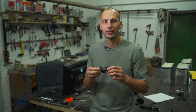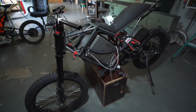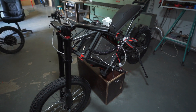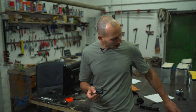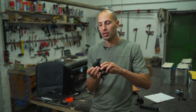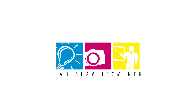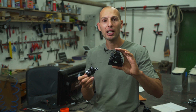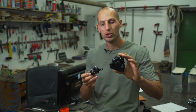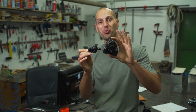Front and rear, you should definitely use bigger rotors like these — 220 millimeters. And if you're playing with some serious power, like we do on these cyber bikes, these calipers might be a good option to consider. These calipers are used on pit bikes, scooters, or small motorcycles, and you can see the difference in size right there.